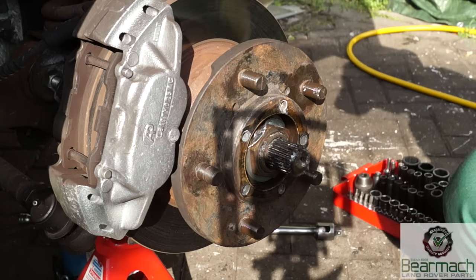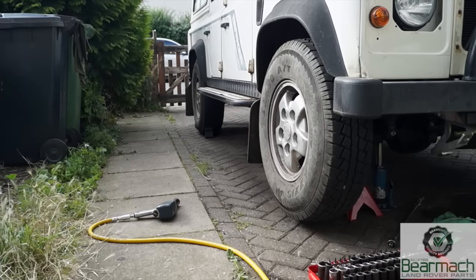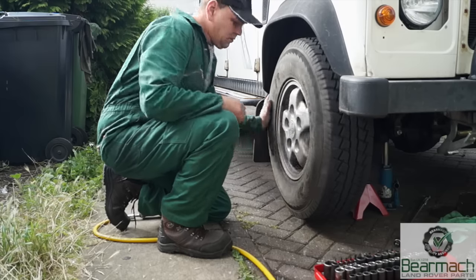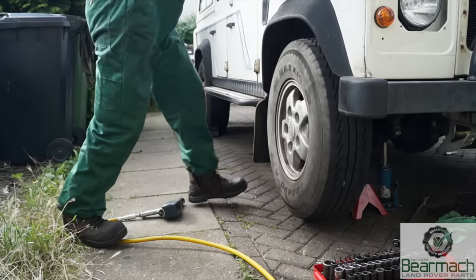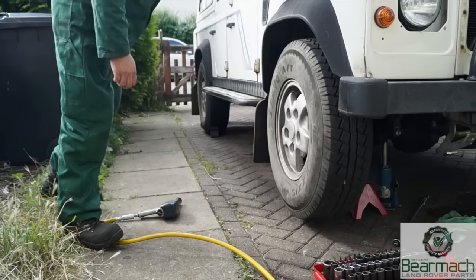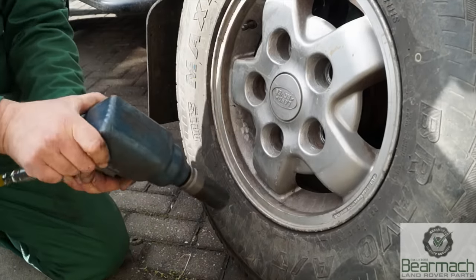In this video we're going to show you how to check for a rumbly wheel bearing. We're going to start by chocking the vehicle at the rear with two chocks, then jack it up and support the axle with an axle stand. I've previously shown how to check for wheel bearing play, but this one we're looking for wheel bearing rumbling if you're suspicious your bearing is rumbling. With a Land Rover, because you have a live axle at the front, it's quite difficult to spin the wheel enough to listen for sound, so we're going to actually remove the wheel first of all.